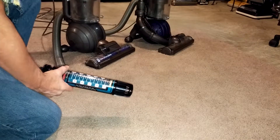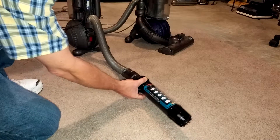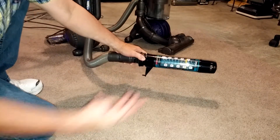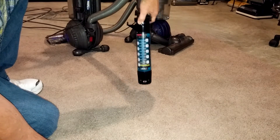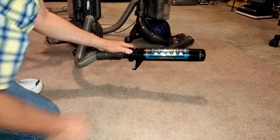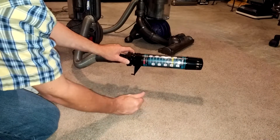Let's actually see that. I've got a DC65 hose here — go ahead and put that on. So we're at about a three. But watch this — now it's a one. Now it's a five. So that's not good. It would really be a three — the top of the disc hits the three line.